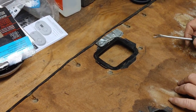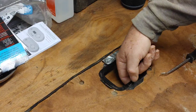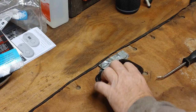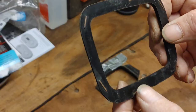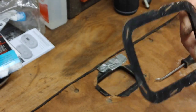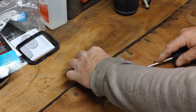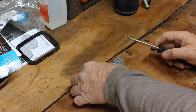We got all the way around and now it's just this part — this here is a plastic ring. This is where your door grab is, where you reach and grab the door; it's like a backer. It came off pretty easy — I didn't even have to pull the staples. I'll have to remove the staples from it to reuse it, probably staple it back into place, but you want to save this piece.